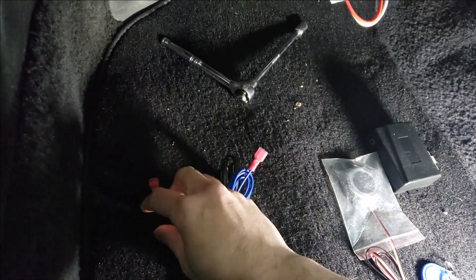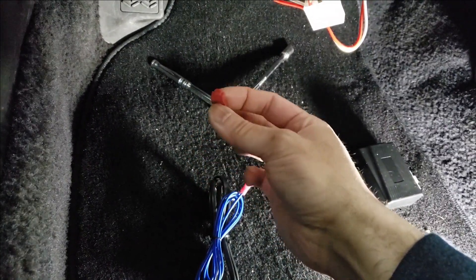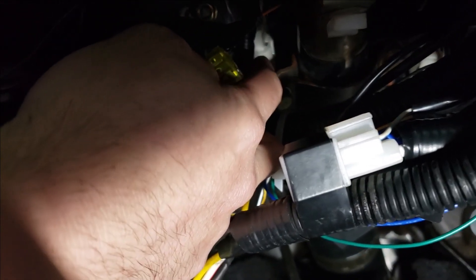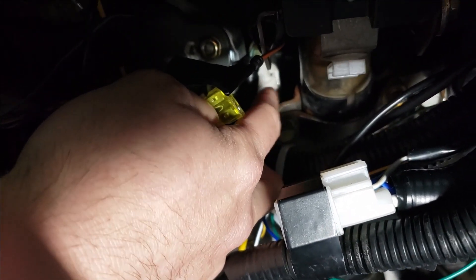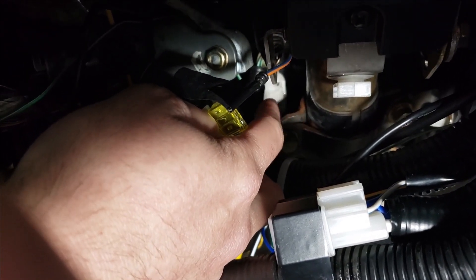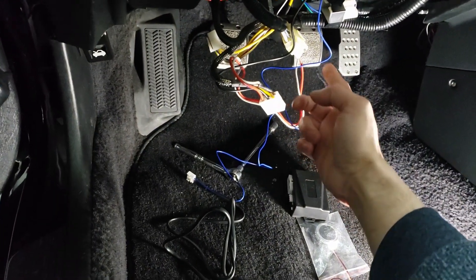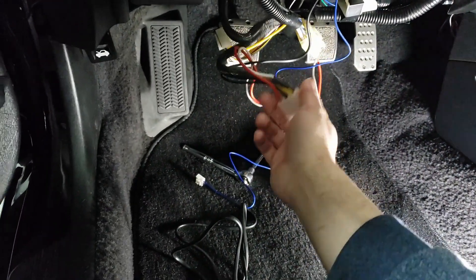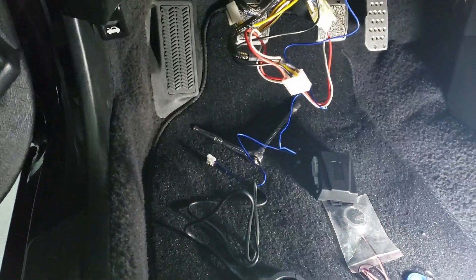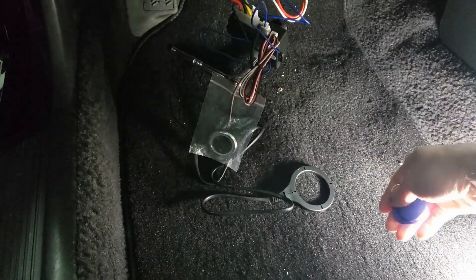After this is all connected, here is your chip reader — it'll already have the connection in it. You're going to need to find the brake switch and tap into it with one of the wire taps, then plug it in. Your brake switch is right over there — that white piece. Find the green and white wire in the loom and tap into it. Once the brake switch wire is connected and all plugs are plugged in, you're going to plug everything into the brain.